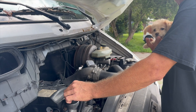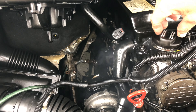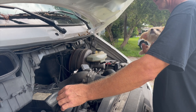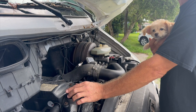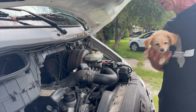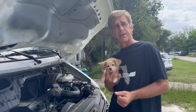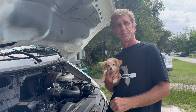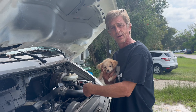Now if that cap is really jumping around like this, that's not good. That's an engine you want to walk away from, or take to the rebuilder as fast as you can. What causes a big cap dance like that is generally a burnt-out piston, where air from the explosion is bypassing the piston and getting down into the block — a whole lot of air flowing out.